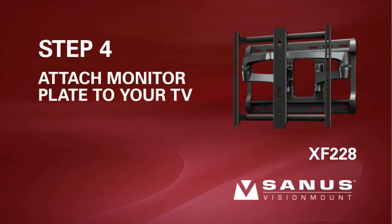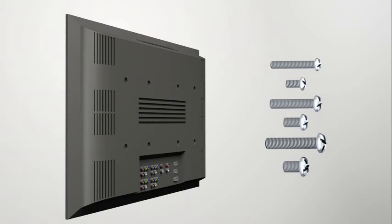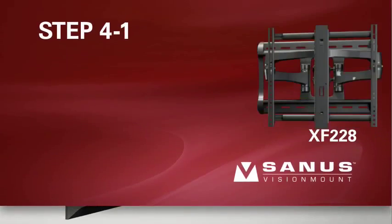Step 4. Attach the monitor plate to the back of your TV. First, determine the diameter of the screw your television requires. Hand thread a screw into the insert on the back of the TV. If you encounter any resistance, stop and select another screw diameter until you have the correct size. The long screws should only be used with the long spacers or they could crack the monitor case.